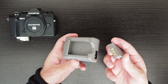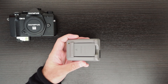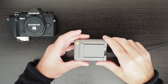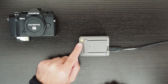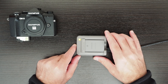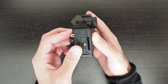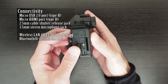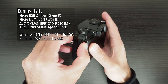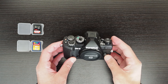If pictures are being uploaded to a smartphone via Wi-Fi using the background auto upload feature, the battery cannot be charged using USB even if the camera is turned off. Olympus has this feature that allows pictures to be uploaded using Wi-Fi in the background, and this continues even if you switch off the camera. You won't be able to charge the camera until the background upload finishes or you disable this feature. Turning this feature off risks losing photos if something happens to your camera or SD card.